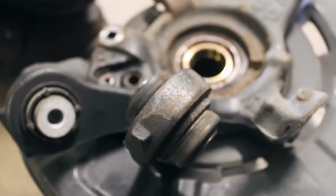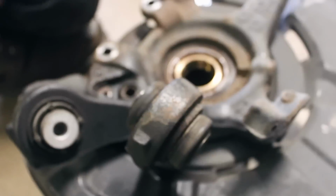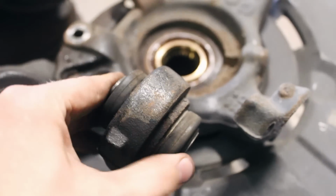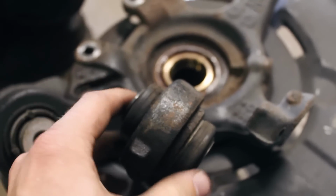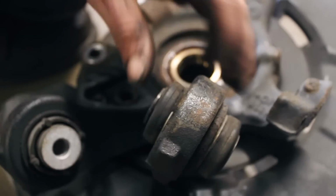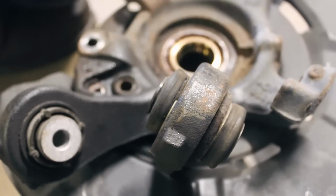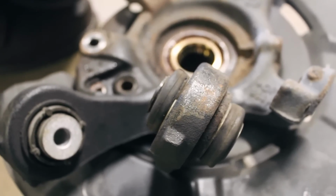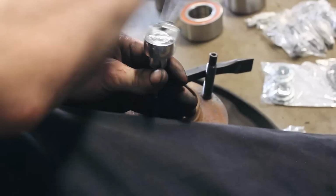And that's the trailing arm bushing? That is the lower control arm. Oh yeah, with the spring perch on it. I think I just have a new OEM bushing to go in there. That's about one of the only OEM bushings I'm getting, because I couldn't find an upgraded one. The ones here from the factory are Heim joints, so they're just about as good as an aftermarket one, so they'll probably last just as long. Sweet. So now we're gonna press these two out of there.